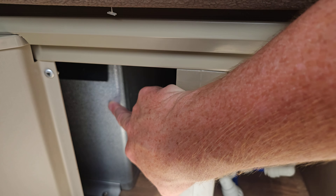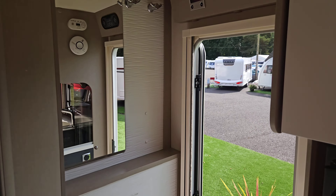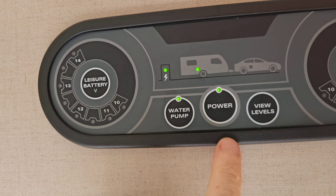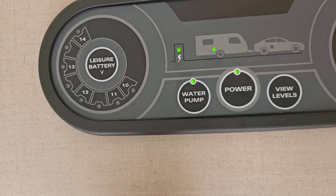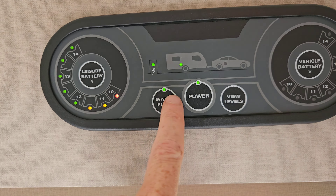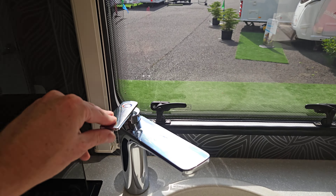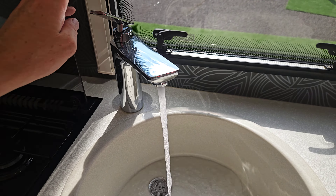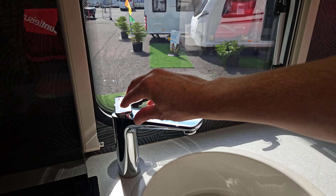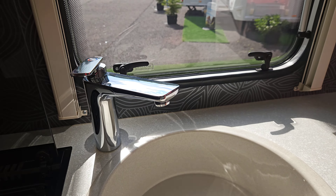The boiler is situated here and will just be full of air, so we've got to push all that air out through the tap. Come to the main panel above and press the main power button — it tells us we've got a leisure battery attached and that we're plugged into mains. Press the water pump button so it's illuminated. Now turn the tap to the hot side and turn it on. You'll get gurgling and spluttering while it sucks water from the aquaroll, fills the boiler, and moves it to the tap. Once you get a steady flow of water — it can take a bit of time, so don't panic — you know you've primed the hot leg of the system.